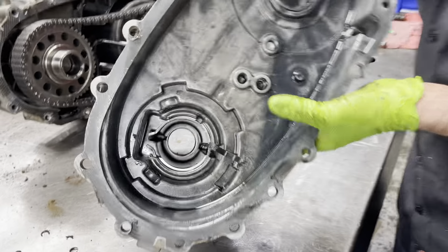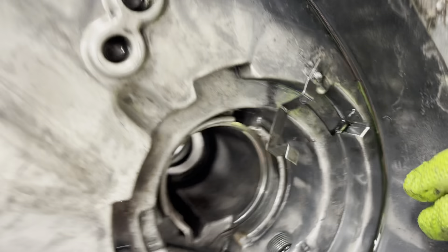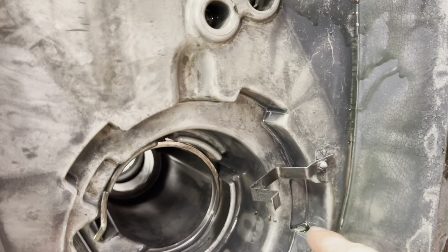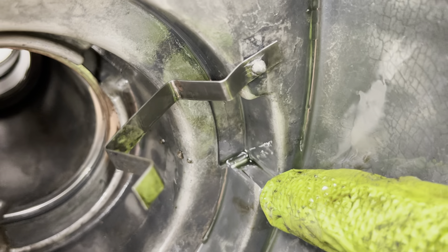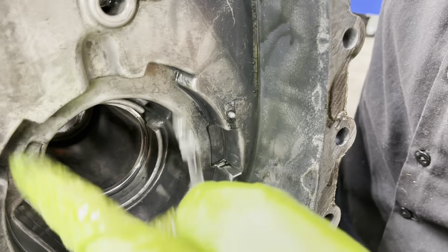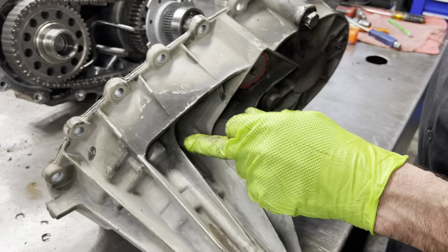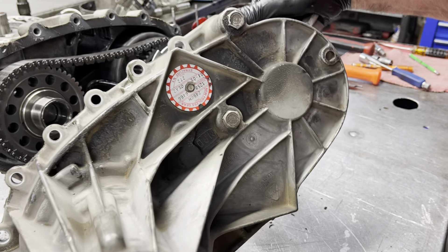Can you see how that started cutting? The oil's in there right now so it's kind of hard to see. It was almost pushing the whole thing through it. So the pump saver we'll put in here — it'll let it push on all four corners and not have to worry about this anymore. It didn't knock a hole through the case or anything, because normally it'll put a hole through here and around here, and so on.